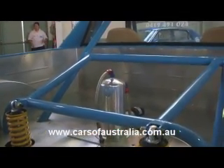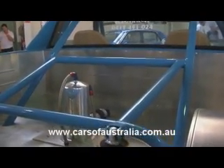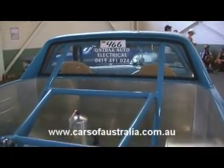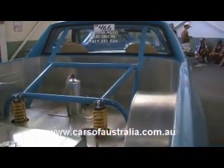The car's been tubbed. The rails have been moved three inches either side. The whole rear of the tray has been sheeted out in aluminium, which was completed by Geoff at Race Pace Engineering in Kirrawee in Sydney. The rear screen is Lexan, just to allow for the cutouts.